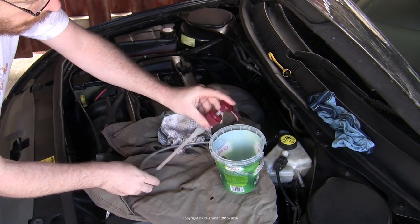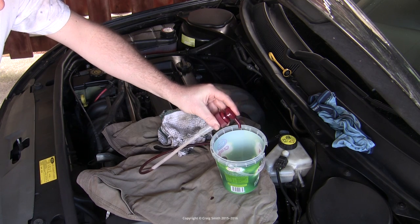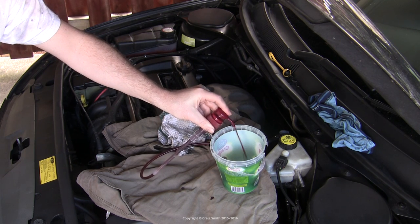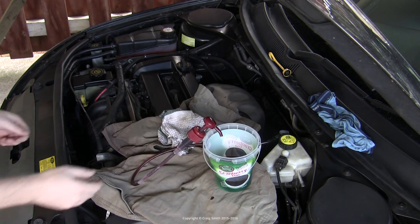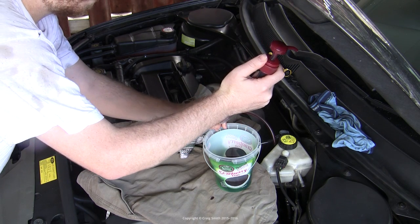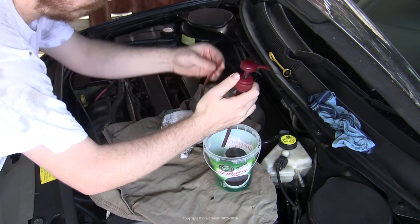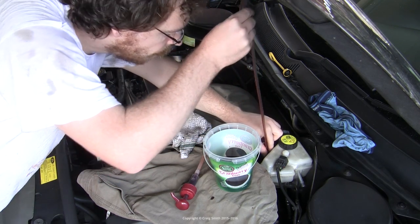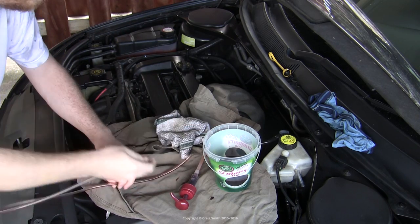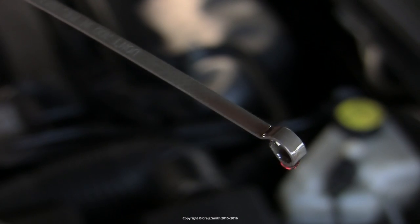I'll show you how to remove excess oil. Obviously you wouldn't want to remove the drain plug again because that's a pain and you'd lose the entire sump of oil — in this case we only need to remove 100 or 200 millilitres at a time. What I have here is this plastic pump off a hand soap container, and a length of PVC tube sized so that it fits over the pipe of the pump and makes a nice seal. The tube is long enough that I can get it down through the filler tube of the transmission into the sump, and then I just pump it out into a container. Remove 100 or 200 millilitres at a time, then recheck the transmission fluid level until you get it toward the low side of the hashed area on the dipstick — that is about perfect.